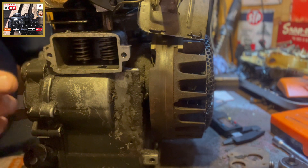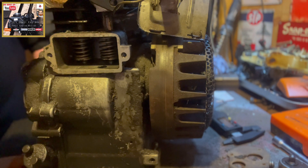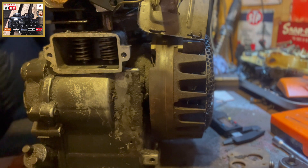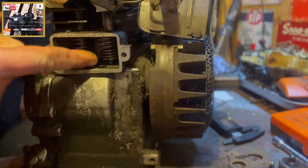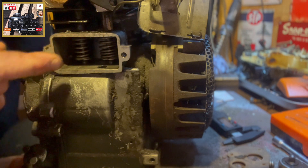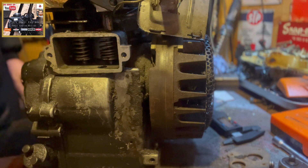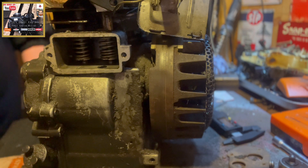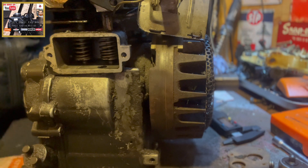Although these are set as they should be - if they weren't, if you've seen the previous video (there'll be a link coming up about lapping your valves) - if they're not seated correctly your valves need to be lapped so they're seated correctly. Also, if the valves aren't adjusted correctly, your valves will have to be removed and you may need to grind a bit off of the valve stem. Failing that, new valves would need to be installed. But apart from that, very simple and easy - that's how to check your valve clearance or valve lash on a Briggs and Stratton horizontal shaft engine.